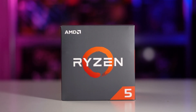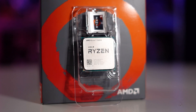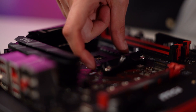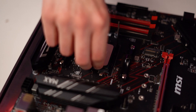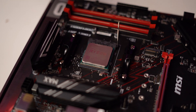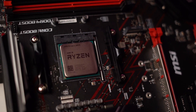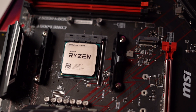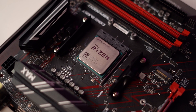The CPU I've gone with is the Ryzen 5 2600X. If you want, you can swap this out for a 2600 non-X to save $30. The non-X versions you can think of as the base level processors with a relatively low power demand and thermal output compared to the X models, which are essentially a beefed up version of the base models supporting higher base clock speeds, boost speeds, and almost double the TDP. Both can be overclocked, however in most cases the X models are designed to be pushed a little harder.